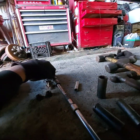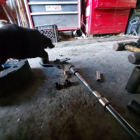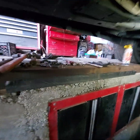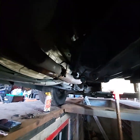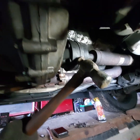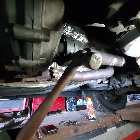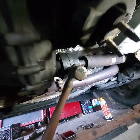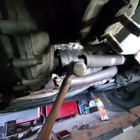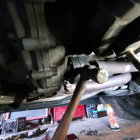The way I've always done things, I put my parts up there and put the bolts kind of where, you know, so things are together and you know where stuff goes. I got that off, and the way I'm going to get this yoke to come apart, I'll use a ball peen hammer and go between those two pieces, and I'll hold this hammer here, and then I'll strike that hammer right there with another hammer to knock that joint out of the yoke.